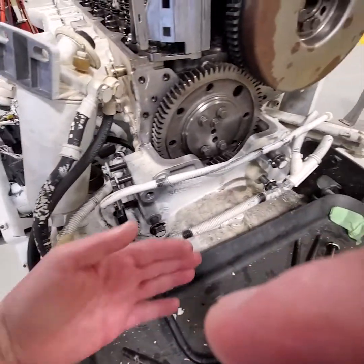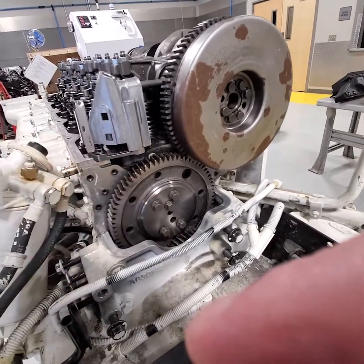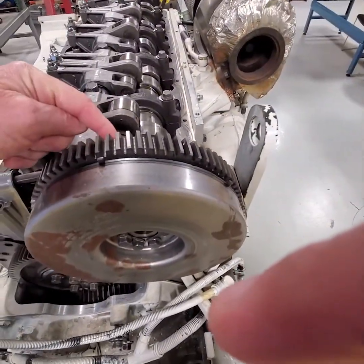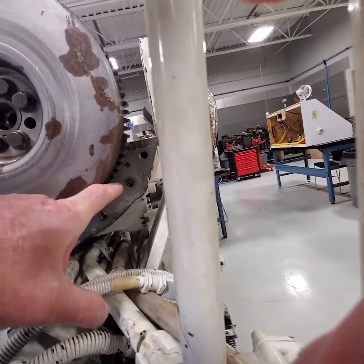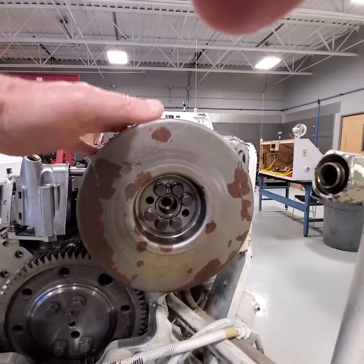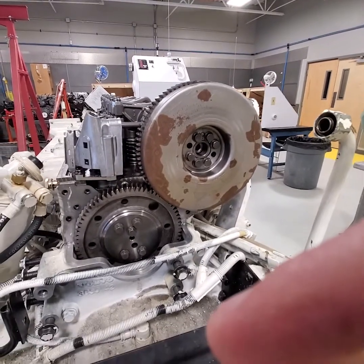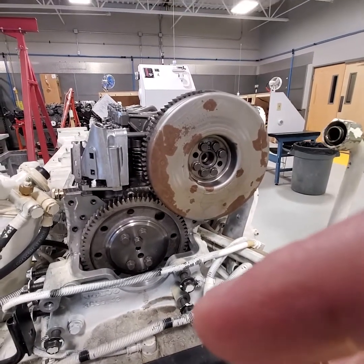When the crankshaft is timed, you'd install the camshaft, rotate it until that mark up there is lined up with TDC, and also these two marks are lined up with that dowel pin — like a double indemnity confirming the cam is timed properly and the crankshaft is at top dead center. At that point you could take it apart without disturbing the engine, so when you put it back together it's already pre-timed.